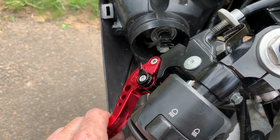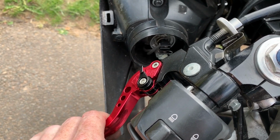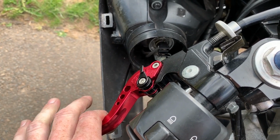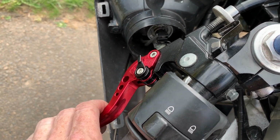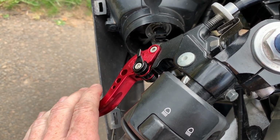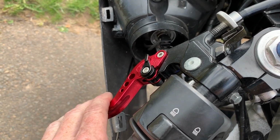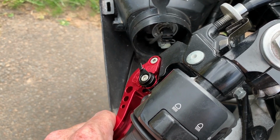like right as I pull in and I can feel it, that's where the clutch starts. And so I have about that much, and then it's all fully engaged. Now, it doesn't slip at all. It's just a nuisance only having that much clutch. So my thought is this clutch is worn out and it's getting ready to slip, because if that's all you have left, you should start to feel something here at the bottom.